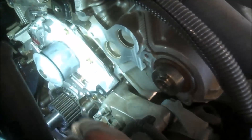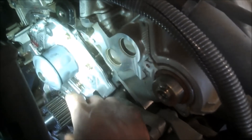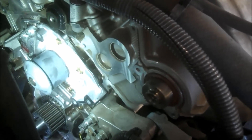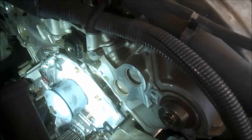Got the new gasket on there and the new water pump. We've got three bolts, three nuts — about 71 inch-pounds only, not really tight. Tighten them down and put our studs in and start the process of putting it back together. Get your timing marks lined up.